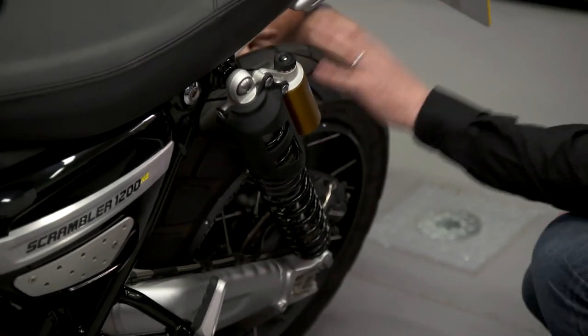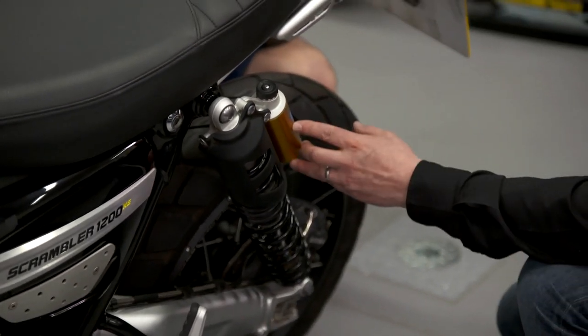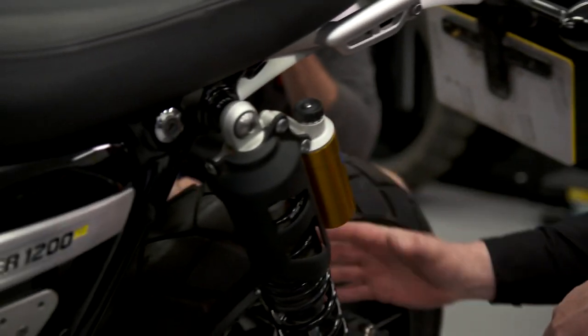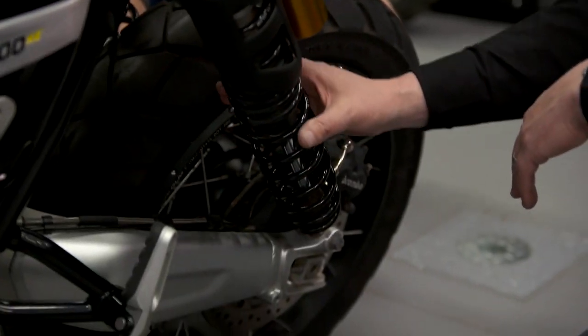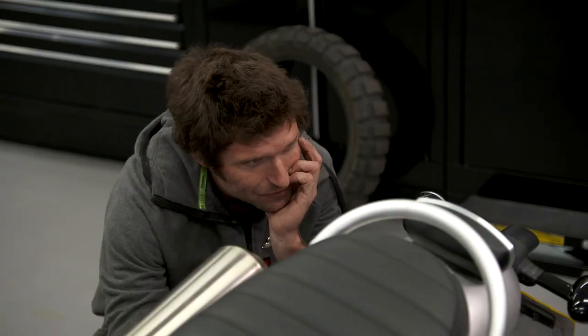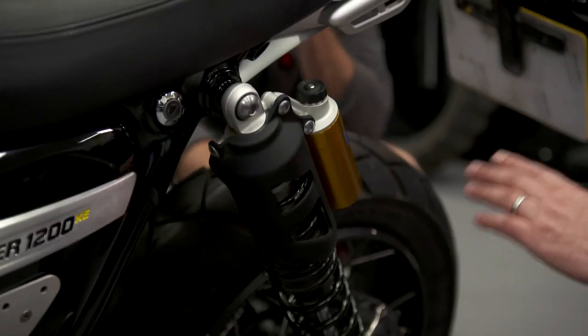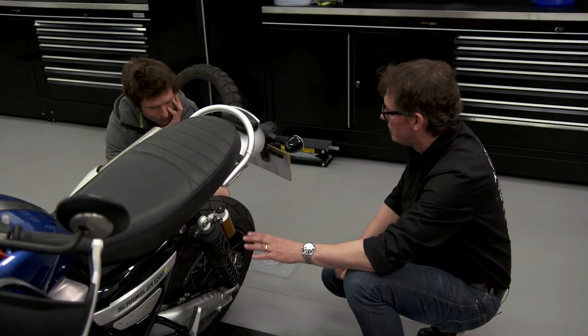On the rear end, we've got a really trick setup at the back. We've got a lot of tunes we can play because we've got a twin spring setup on each side. There's a first spring with a stop and then a variable rate spring at the bottom. So it's quite sophisticated — we're trying to get all of the technology that's been developed with monoshock into twin shock.